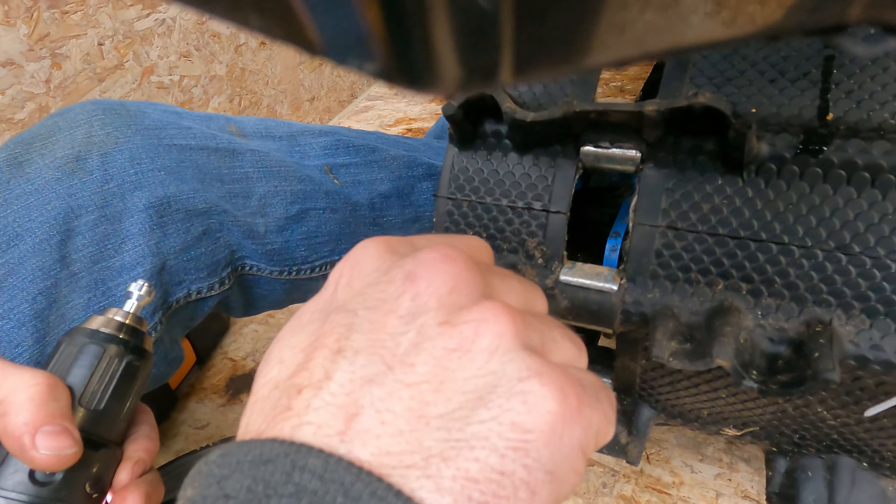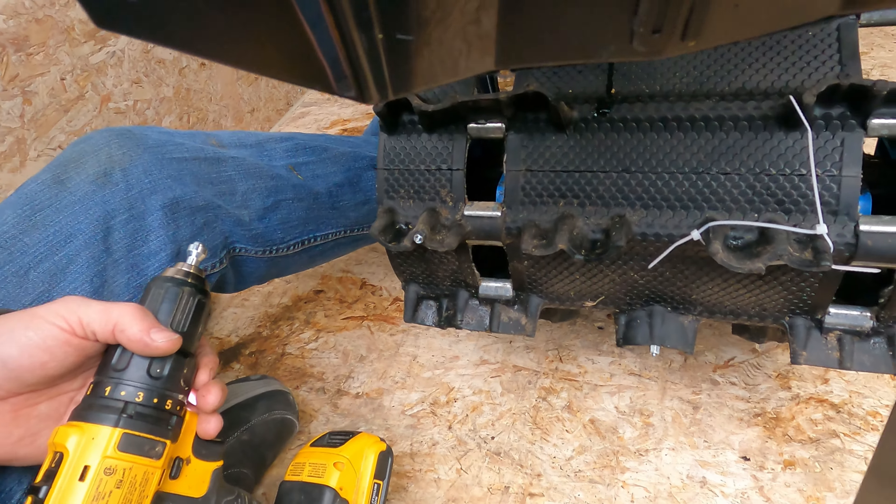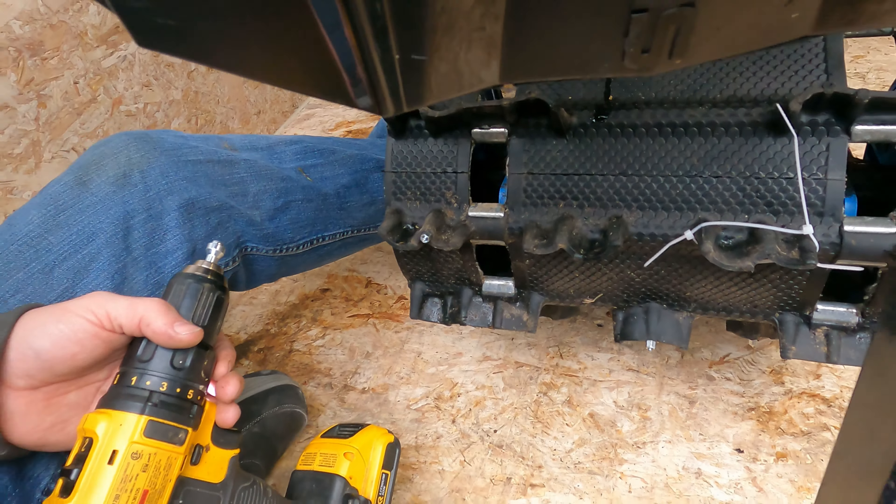You could see how it was twisting the lug — without a pre-drill it really rips through. I did try one on one of the outside lugs earlier and that's another thing I would not do: it just twists too much and you risk ripping it out. Always go on the center or one of the more inside lugs where you have material on both sides.